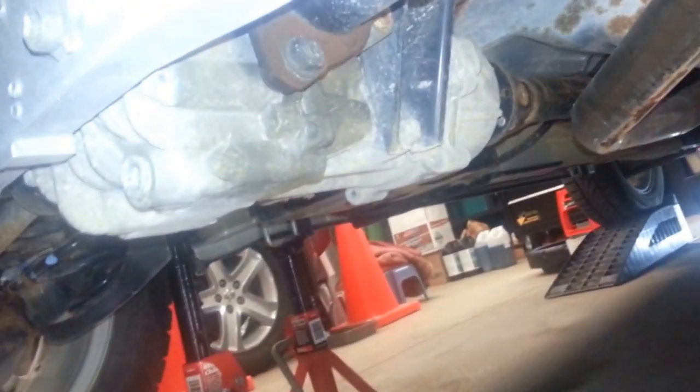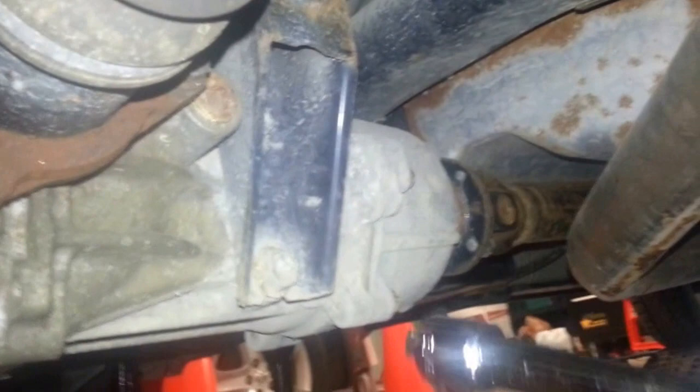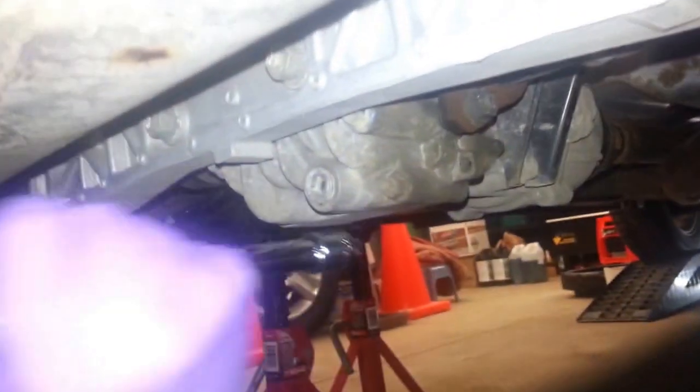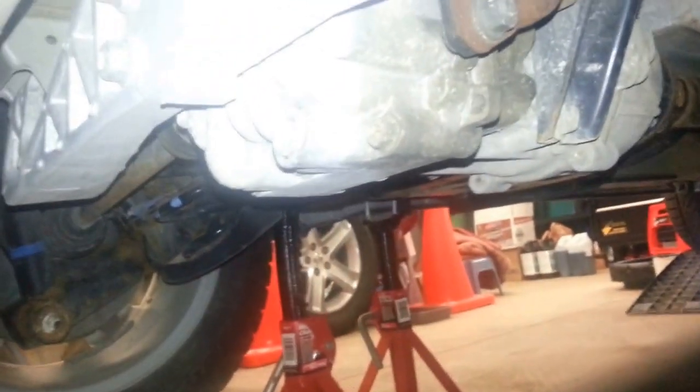Okay, moving to the rear differential here. So this is obviously the back of the car, the muffler. There is the drain right there, and then the fill plug and check plug is right there. Unfortunately I can't do this one-handed, but just stick your tool in there. You can just use a 3/8 extension there. Obviously loosen the fill plug first, just in case it's seized, and then there's the drain right there. And then I'll show the fill process in the next step.